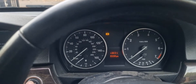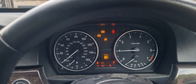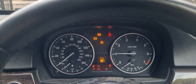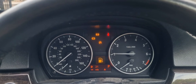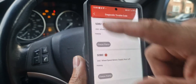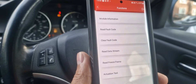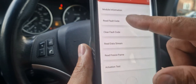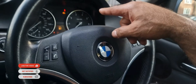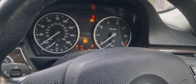Starting the car up, the warning lights are still on, so I need to put the diagnostics on and reset them. The fault codes are still showing, so I delete them. After deleting, I read them again — no fault code. The lights have now gone off on the dash. We're going to take it for a test drive and see how it goes.